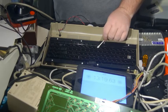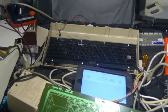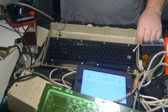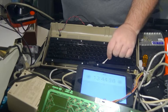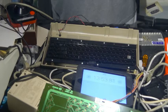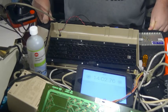But if I was going to do what Bil Herd needs to do, because of the broken keys, the ones with the broken stems would fall out nicely, because of course there's nothing to hold them. And then, once you're at that stage, you need to put fresh stems in. Oh, I don't think I did the spacebar. You need to put fresh stems in, and then put, of course, the spring and put the key back on. So, do I have to do that? No, I don't. Why? Because nothing is broken of that nature.